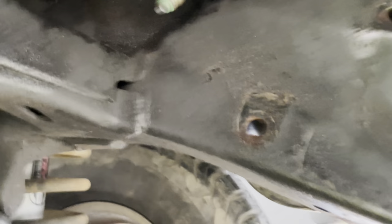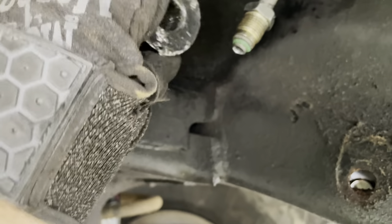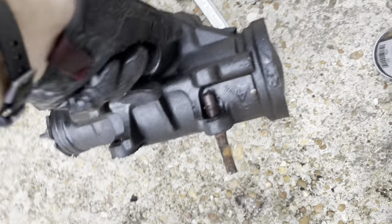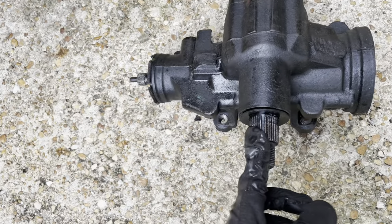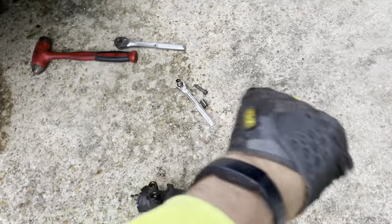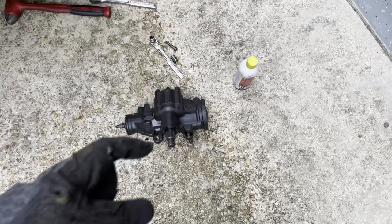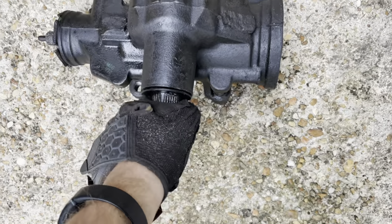Alright, steering box is out of here. A little concerned about the splines on the steering shaft — I guess they're alright. The U-joint feels okay — yeah, I think those will work. Steering box — if any of you want to know what a junk Dodge steering box looks like, that's it. These second gens have notoriously loose steering. The pitman arm shaft in these things has a lot of side-to-side play, so it wears out pretty bad — that's what causes the issue where you can turn the wheel and it doesn't actually turn. That design puts a lot of side load on those bearings.